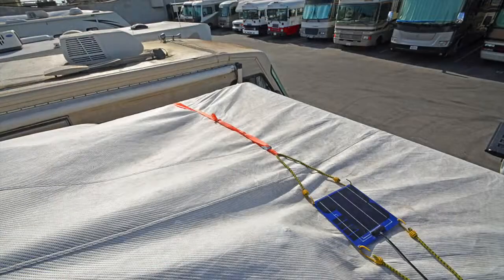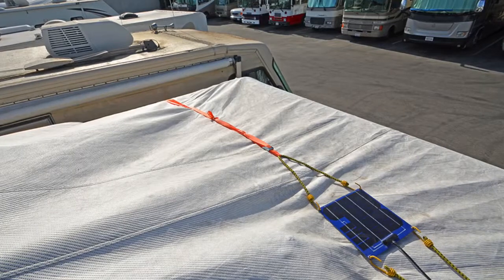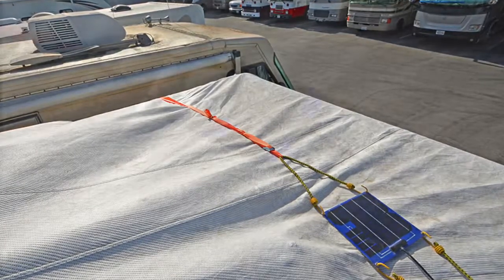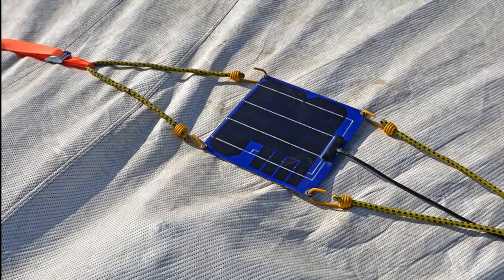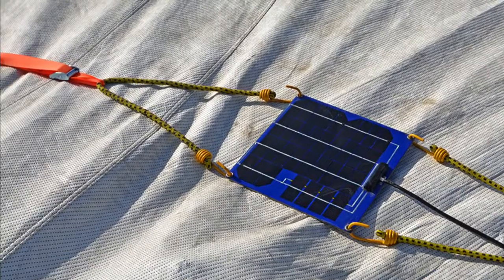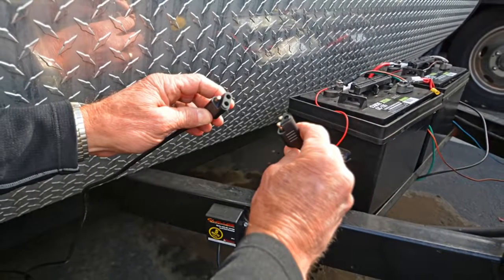The final part of the install is the solar panel with its integrated 20-foot cable. In total this is a very simple install that shouldn't take more than an hour depending on how you decide to attach the solar panel to your RV. Pulse Tech recommends the SP5 be mounted using four round head screws, industrial adhesive, or a heavy-duty dual lock or double-sided tape. In my case, wanting to have the panel on the outside of the cover — I want what I want — I decided to take advantage of the grommets on the corners of the panel and rig up a shock cord and cargo strap configuration that is quick to attach and detach when putting the trailer in storage or heading out for a trip. The cable from the panel and the controller have very convenient quick connect fittings, so once the panel and controller box are mounted and the controller is attached to the battery array, connecting the solar panel to the controller is a snap.